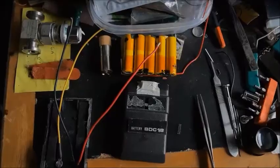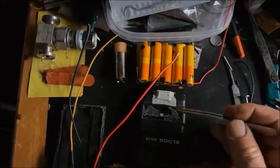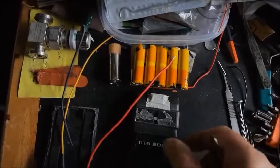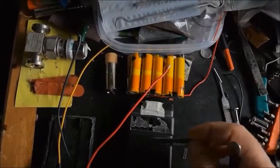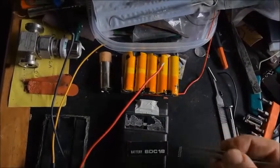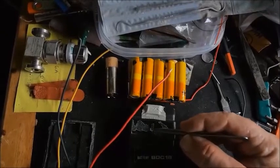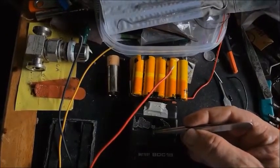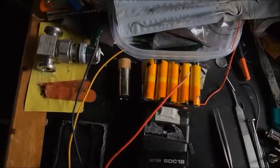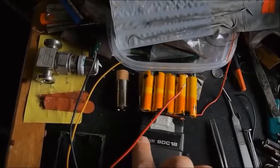Here's the little Japanese box trick: inside here is a lever — you can barely see the tip of it. What has to happen is you take this label off, which exposes this little hole. Then you get the battery all back together, take this little spring and stick it through the hole onto that metal tab in there. That makes this button work so it goes up and down and releases the battery, and then you glue the label back in place.